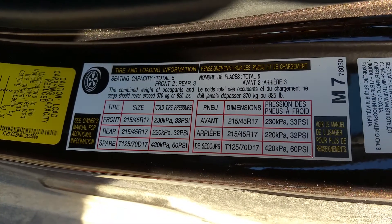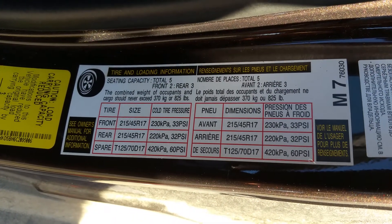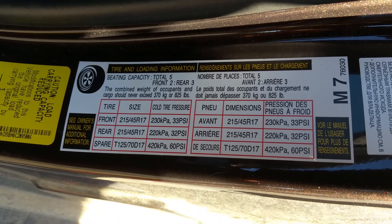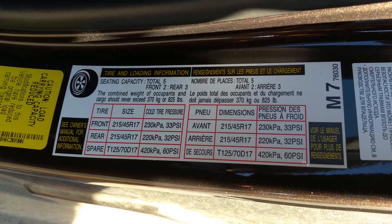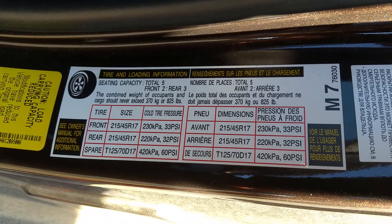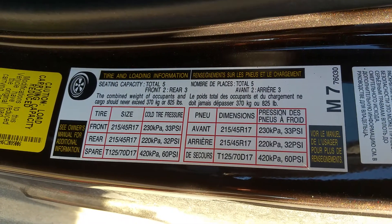You've got to wait about an hour after you finish driving, and make sure you're parked in the shade. And of course these are going to change. If you're checking your tire pressure in a cold area and you're going to drive down to a really hot area, well, you're probably going to be overinflated.